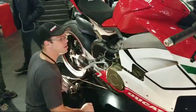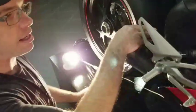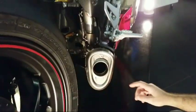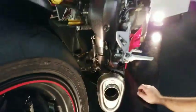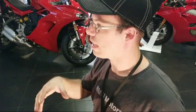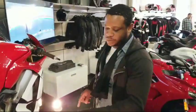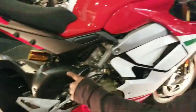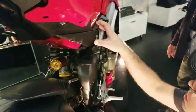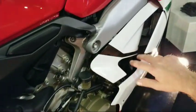What do you see, Steve? I'm just looking at the exhaust right now — the full Akrapovic system, checking out the placement of the exhaust ports. On the 1299 and 1199, it was very tight here because all the pipes were bundled up. Now there's a big chunk of space that's wide open with the exhaust exit down here. With the heat, the coil used to go all the way up, but now it's been toned down quite a bit — it's all the way at the bottom. So in theory, this should be cooler than the 1299s and 1199s, and we have a lot more heat extraction from the cooling system away from the rider.